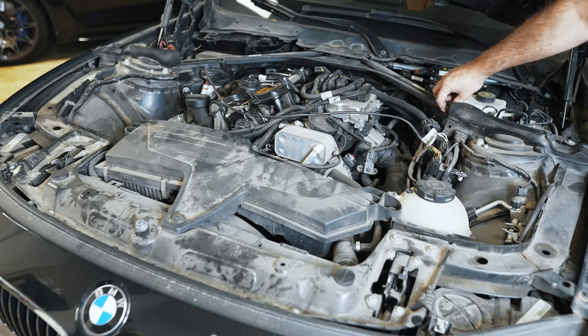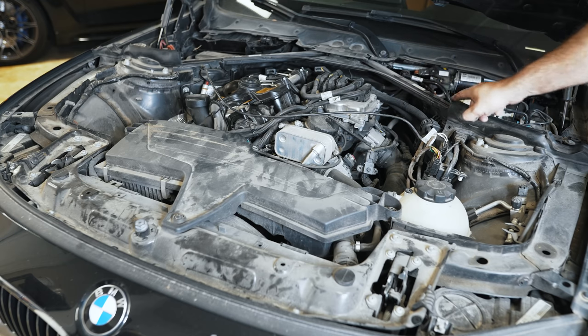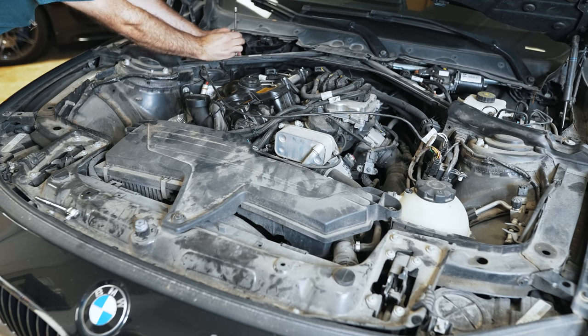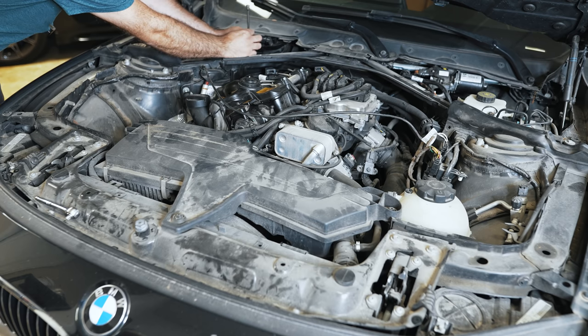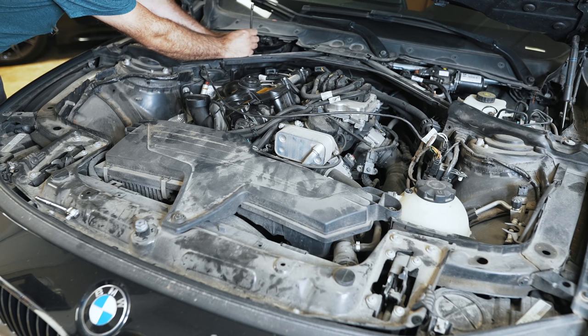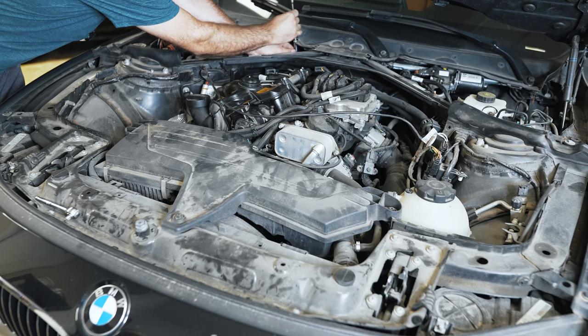That timing chain gear sound turned into a rattling sound and the drivetrain malfunctioned. There was skipping and missing and rattling. The car felt rough to drive. He basically decided it's now time to park it. He was getting low oil pressure warnings. I told him if there's low oil pressure warnings, that's actually really bad — it's probably what we didn't want to see. It could be due to the oil pickup getting filled up with bits of timing chain guide and blocking it. And if you drove it hard at all or for a prolonged period of time like that, it could have damaged the engine. So then I went to check the oil filter before we proceeded with anything further and found that the oil filter was perfectly clean, which is what we need here.